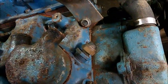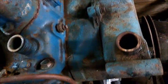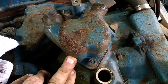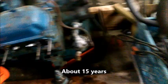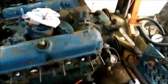I've blown off the areas that were really crusty to reduce the chance of stuff falling down into the engine. Now this piece here sat outside off this manifold for a long time and the bottom side was really super rusty when I got it. I sanded it down as best I could and gunked it real good, not knowing how easy it was going to be to find another piece. The other motor's piece is in great shape — it looks better and isn't rusty — so that one's actually going to go on this engine.